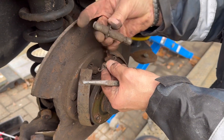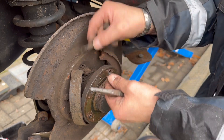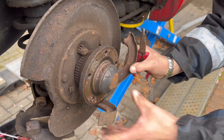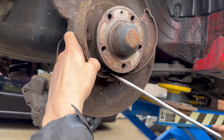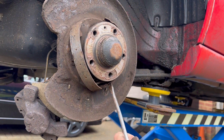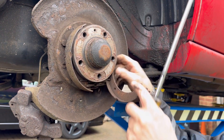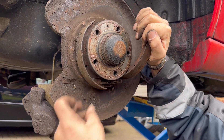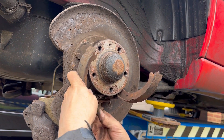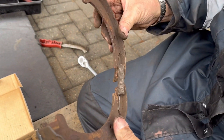What we've done is stretched the spring and got that in between the two brake shoes so it dropped down - that then lets the spring pressure off so we've unhooked them. Put them in a box to keep them because we don't want to lose them. You can pull the pads off like that, get hold of the spring at the bottom, get that one off and get that one off. That's the easy part - getting them off.